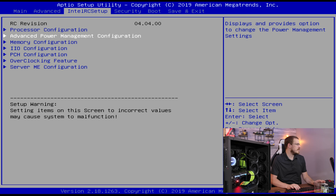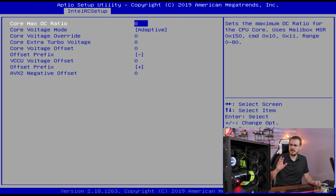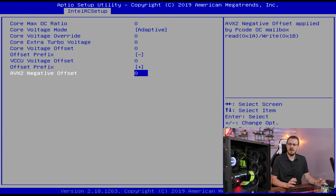Once that is all set up, go back all the way to the Intel RC Setup and go down to Overclocking Features. Scroll down to the Processor menu — this is where you enter the unlocked multiplier value for the CPU. I've already dialed in what the CPU can handle, but if you haven't overclocked your chip before, you're going to want to go through the steps of making sure you get a stable overclock. For gaming workloads, I peaked pretty much right around 4.2 gigahertz at what I consider a safe voltage of 1.25. Now, this motherboard BIOS, while probably the most complete I've seen out of a Chinese market board, still has its bugs and issues. For example, the AVX2 negative offset option at the bottom doesn't actually work, which is unfortunate because for gaming workloads I was able to get the CPU all the way to 4.3 gigahertz at some fairly safe voltages. However, Cinebench would crash about halfway through every run at that 4.3 gigahertz level. Ideally, I'd like to enter a value of 2 here, which would reduce the processor speed by 200 megahertz and allow Cinebench to run stably at around 4.1, but this menu option doesn't actually apply.